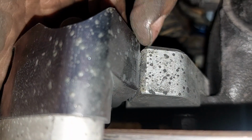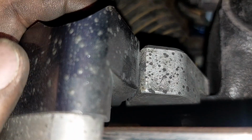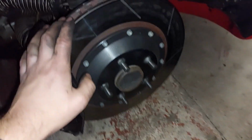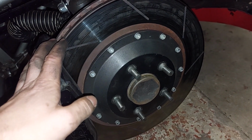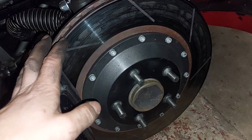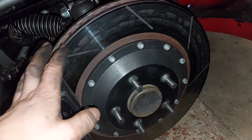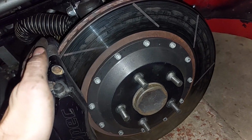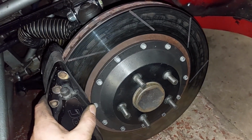And then my plan is that I'm just going to put a spacer straight down there, push it out. These are 343, I believe. I'll measure them properly when I get it off. Sure, they're 343, new ones are 360, so that's a 17mm increase. Divide that by 2 is 8.5, so it's 8mm-ish. I need to space them out, isn't it? But what we're going to do, get them on, put the caliper up against it and measure the gap. That's the plan, and then we know exactly where we are with this one.